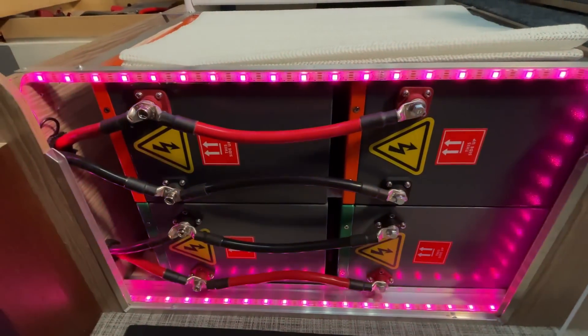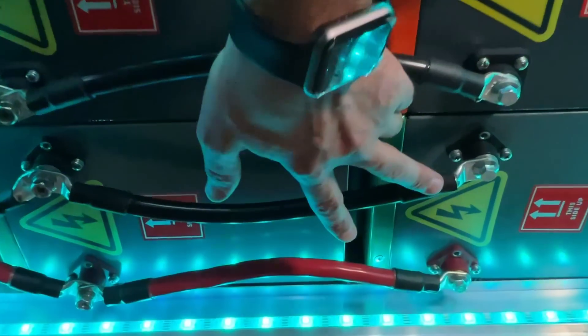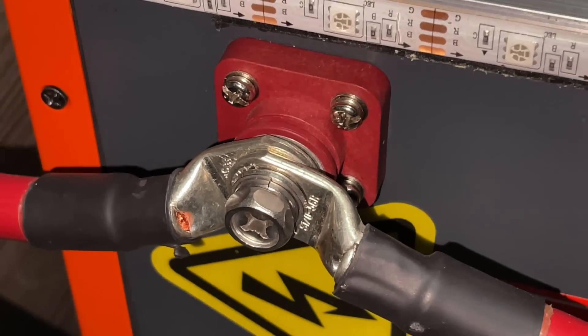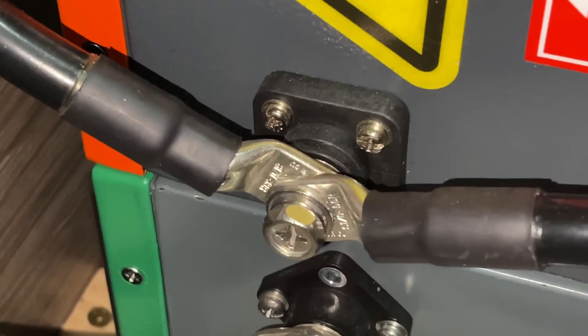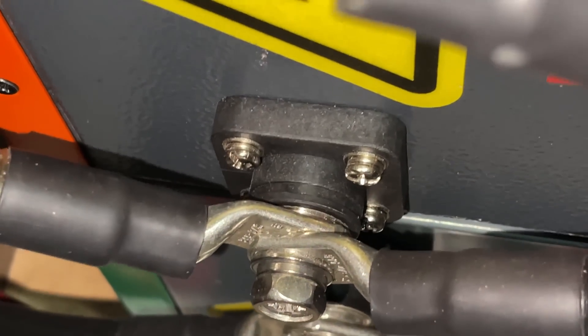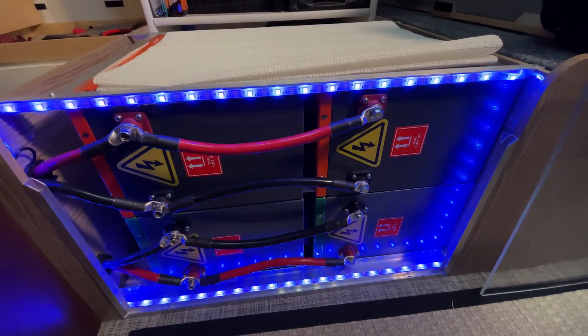It's really hard to show you this because there's just no space. These are the original batteries and I swapped out the terminals — I like these better, they're much stronger. The new batteries also have the new terminal style, which are much more durable and really stout. These are stainless steel cases, each 300 amp hours for a total of 1200 usable amp hours. This is a Coleman Mach and it's a 9000 BTU AC — I tested it in 90 degree temperatures and got 12 hours of run time off of 600 amp hours, so with 1200 amp hours I could get about 24 hours.